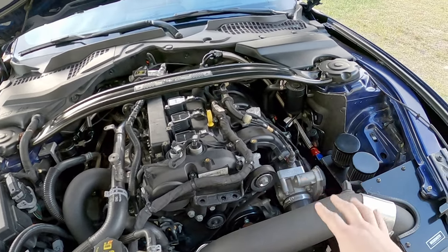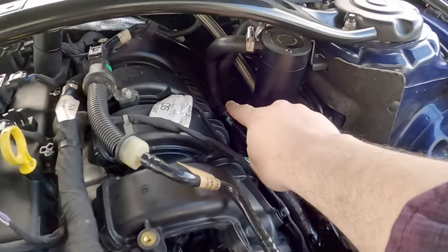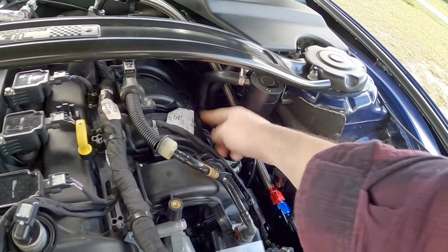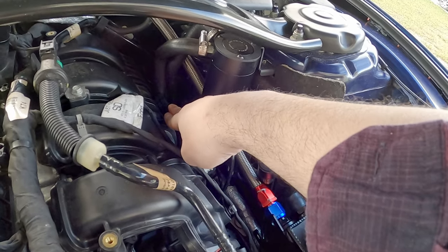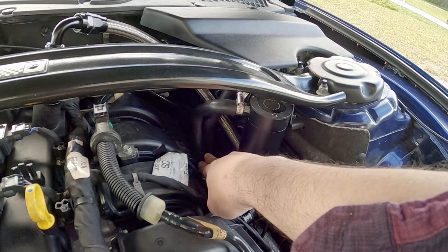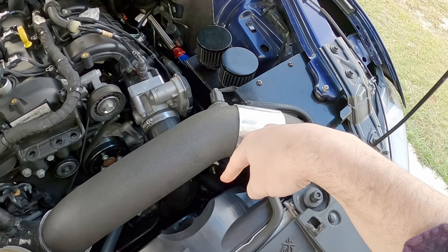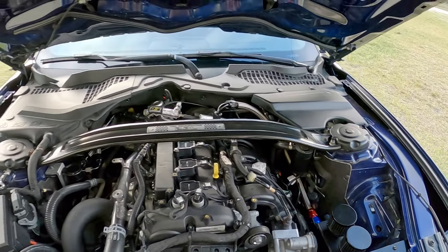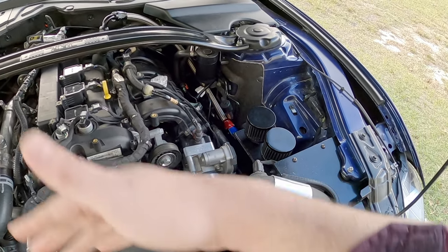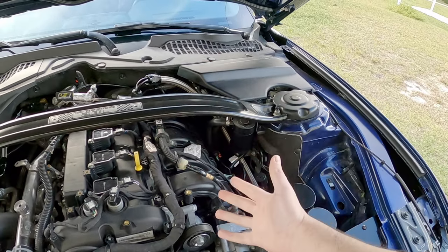In a nutshell, what was really happening — remember, there are two boost sensors. There's this one in the manifold, which is the important one. This is the one really telling you how much boost is entering the engine; this is the one you don't want to see any excessive boost pressure at. Then there's also another sensor down there in the intercooler — that's the TIP boost sensor — and that one is less important. However, it is equally important to make everything work, because it has to work together with the MAP sensor for the system to function properly.